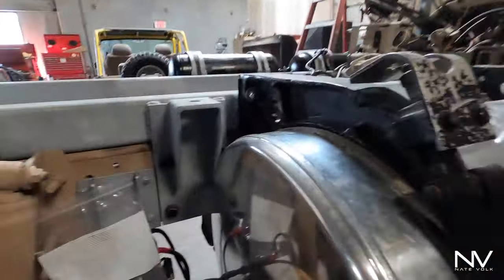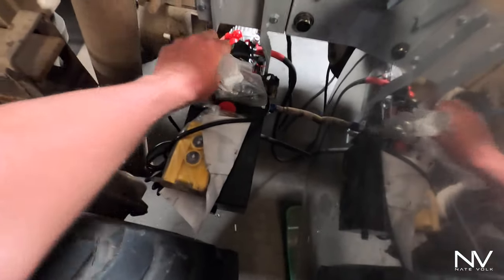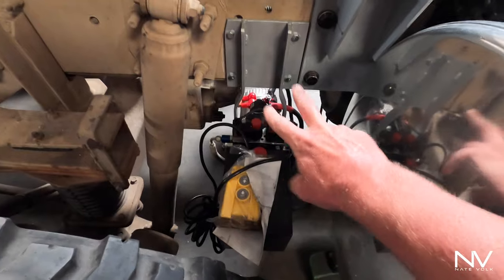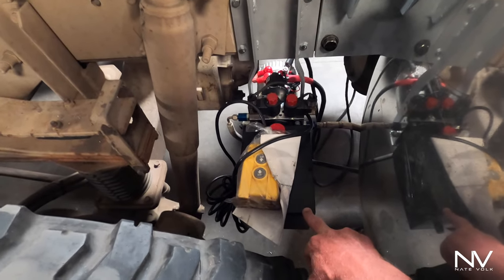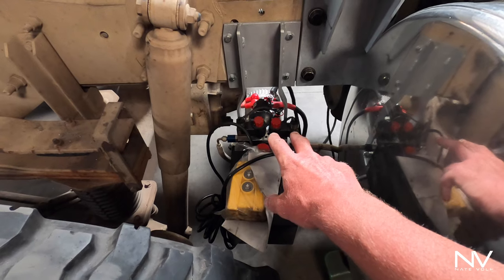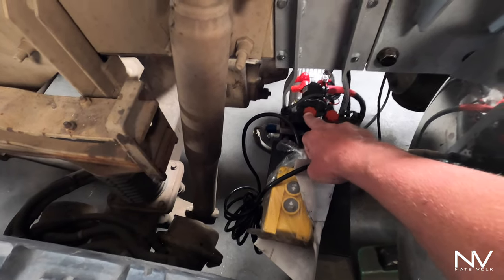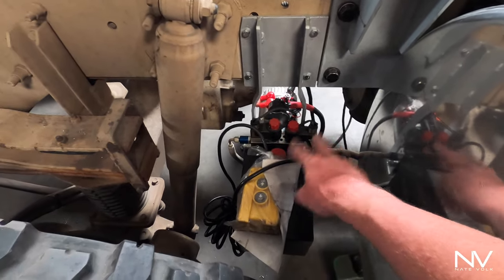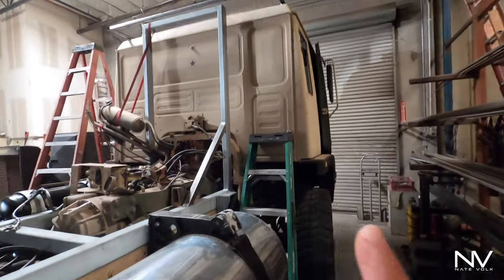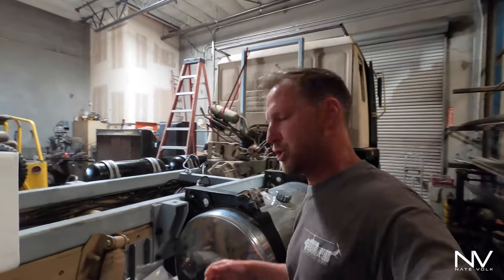Over here is my gas tank, front tire, rear tire, and hydraulic pump and tank. I'll put a link to this in the description. This whole pump and reservoir — it's a three-quart reservoir which is way more than what we need. I got a 12 volt pump because it was like half the price. This whole setup was less than 200 bucks. It's got two 12 volt relays, it's dual action so it'll pump both up and down. Right now I just have two hoses hooked to it because it's hooked directly to the cab tilt. Eventually I'm going to change that and put in a spool system with some handles.